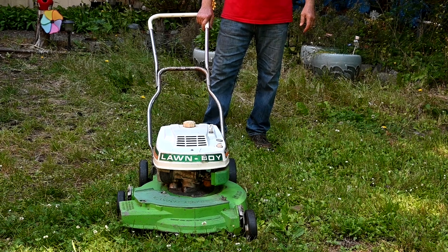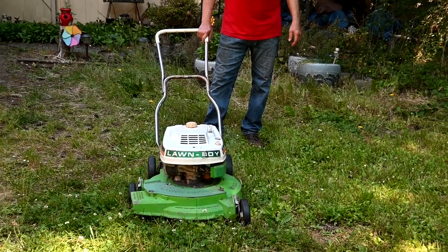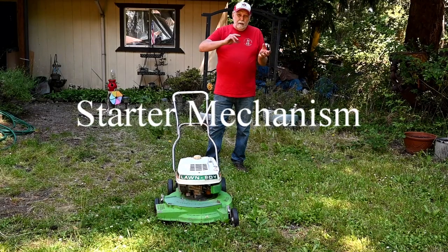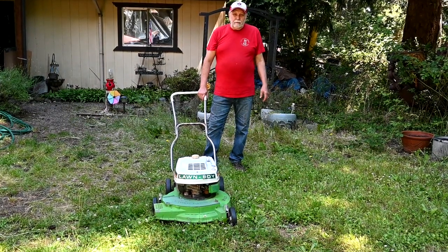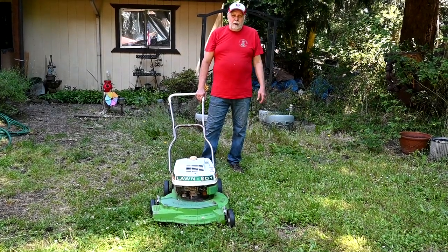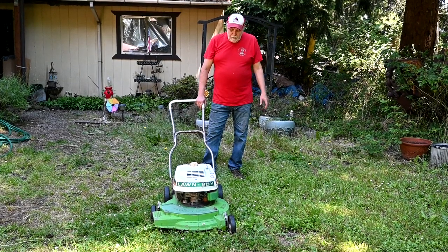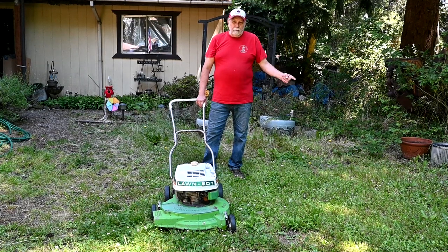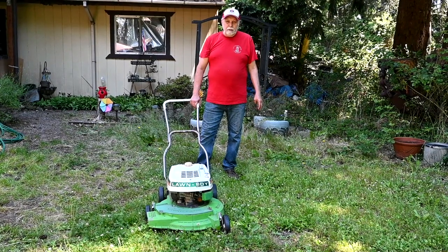So I bought it, and it was probably 35 years ago. Been using it ever since. And all that was wrong is they have a drive system. It has a screw like that, and it got debris in it, and oil and stuff, and made it so it didn't work anymore. I just took it off and cleaned it, cleaned the carburetor, put a new plug in it, and been using it ever since. And anyway, I like using two-stroke lawnmowers. One, I like the sound of them, plus they're vintage, and almost zero maintenance on them.